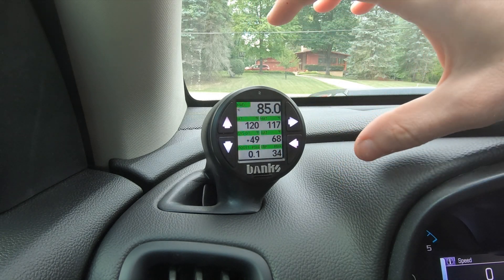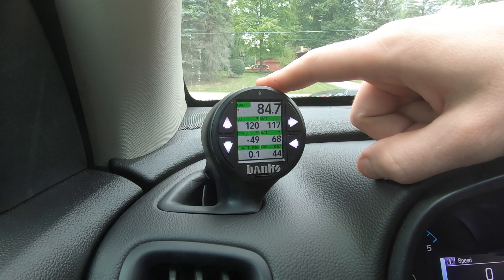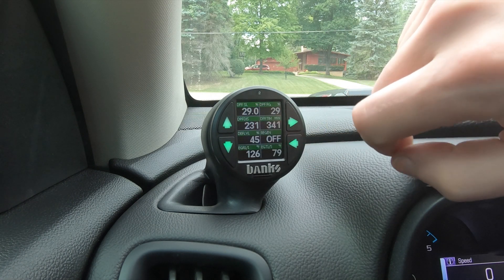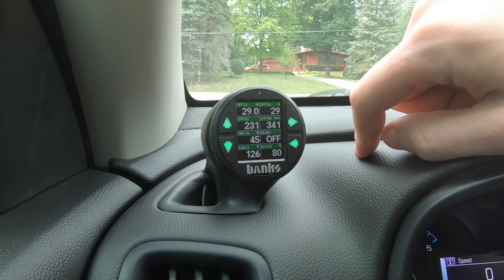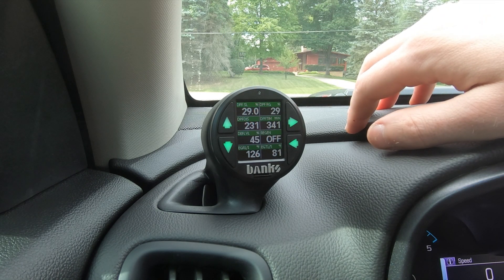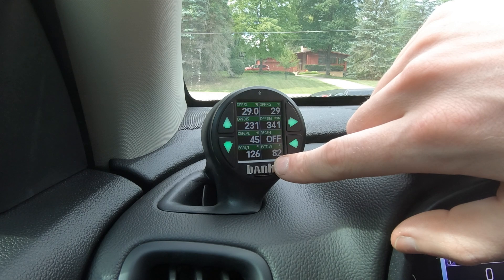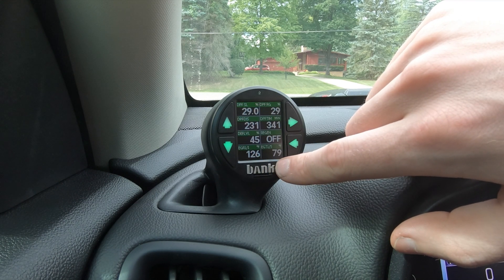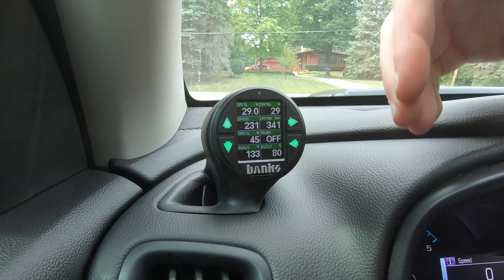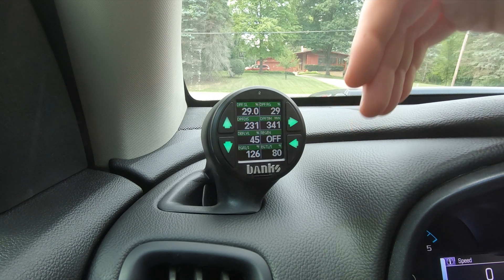You can also daisy chain up to three more iDashes in addition to the primary one, so you could have four in one vehicle. If you set up an eight-gauge display on each iDash, driving down the road you could be monitoring 32 different parameters at any given point. That said, it can turn into data overload — especially monitoring exhaust gas temperatures, where values change very, very quickly and it gets hard to digest. That's kind of where the data logging model comes into its own. If you have issues, rather than trying to figure out what's going on while driving, just pop the card in the reader, hit the log button, start a log, and take it for a ride.